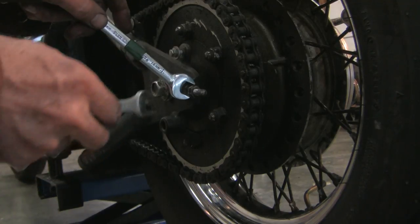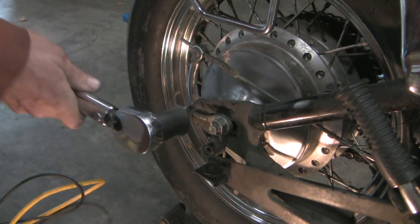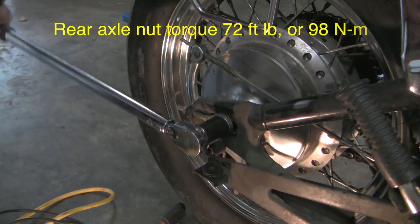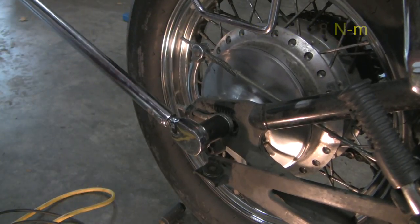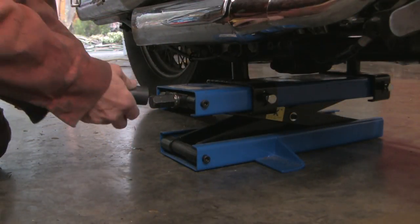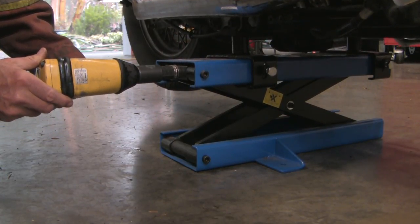Once you're sure your chain tension is right, your final adjustment is always done by hand with open-end wrenches - you turn the two against each other so it's nice and tight. The torque spec on this is 72 foot-pounds. And here's a new cotter pin - we could have reused the old one honestly. On that first trip around the block, remember you've got a new slick tire and newly adjusted brakes, and if you forgot to take the tape off that drum you're in for an exciting ride. That $50 lift turned an awkward two-person job into an easy one-man effort - a little tool like that pays for itself in one wheel change.